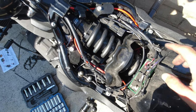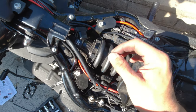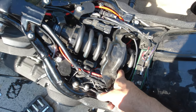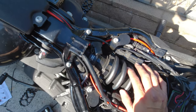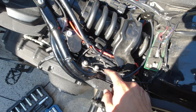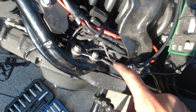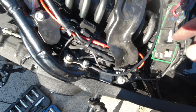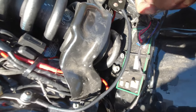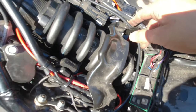We just finished wiring the battery to the stereo wires. There's no fuse in it yet — it's a good idea to leave the fuse out until you're ready to finish the install, because you might still be cutting or soldering. Once it's connected to the battery, pull the fuse until you're done. Here's where I connected my wire — I think this one is my LP6 and this is the stereo system. I'll zip-tie the wires away from the shock, and I also have a Fox shock back here.